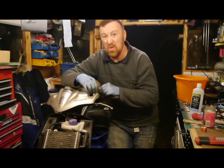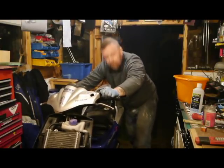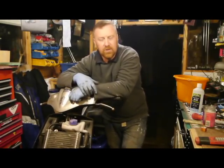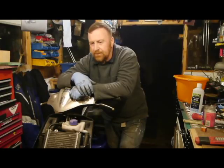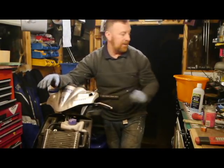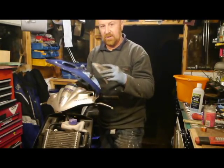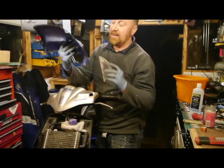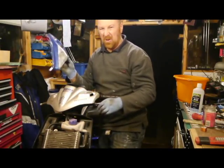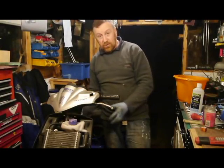So that's your electric start. Now let's switch gears up. The camera might not pick it up but it goes, and you get a little tiny bit more - that's where it's opened up perfectly. Now there's not even that jerk you get. That is smooth running, really well. I've got it at two and a half turns and it smells a little bit rich. It needs a good ride now so I've got to put it all back together again. Loads of missing bolts at the front.